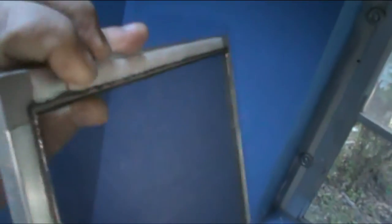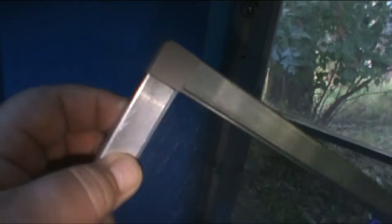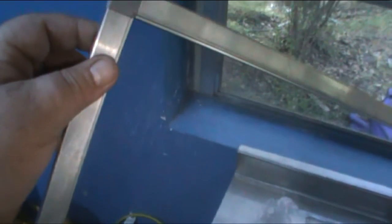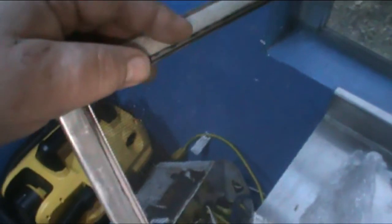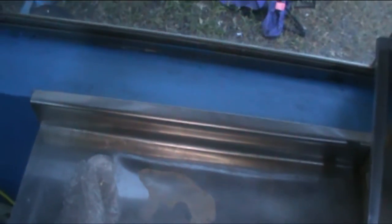For summertime, what I do with the windows is I made these screens, and they attach with Velcro. You can go to any hardware store and get this material — these come in long strips, you have to cut them. It's easy to cut, just use a hacksaw or something, and these plastic corners. I like to use the nylon screen, but the aluminum is probably better and will probably last longer, though I haven't had any trouble with these breaking yet. There's a little groove on here, you put them in the groove — there's a tool, kind of a roller thing, that you put this rubber stuff in. You only need to do it on the top window, because the top part comes down. This really helps a lot to keep the insects out of your bus when you roll the windows down.